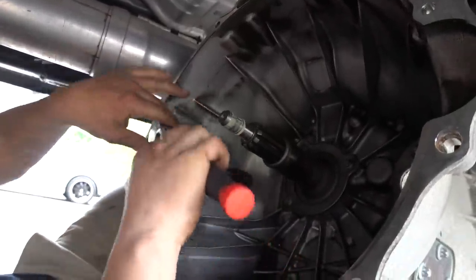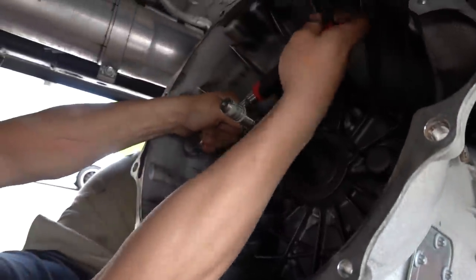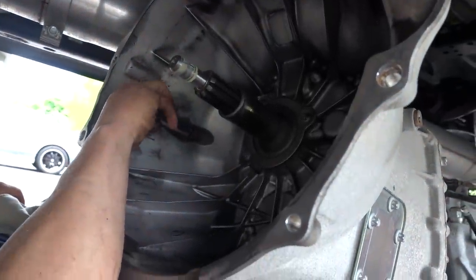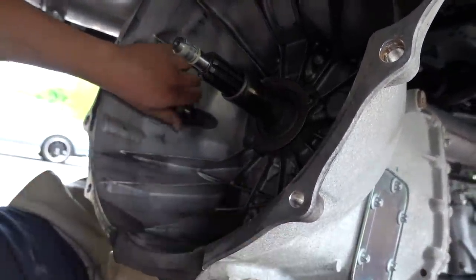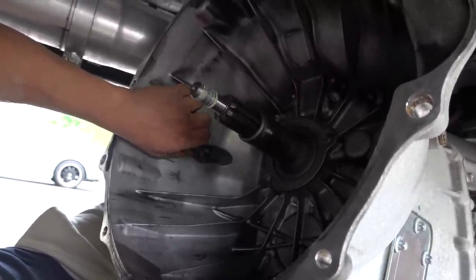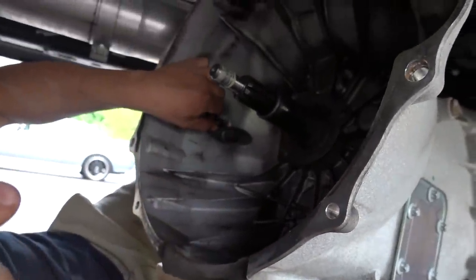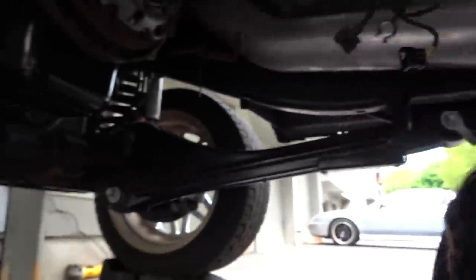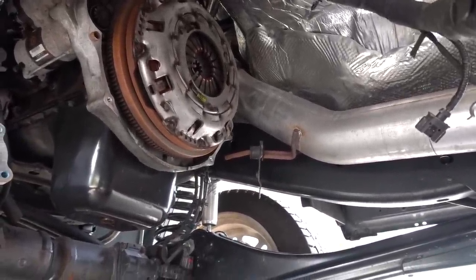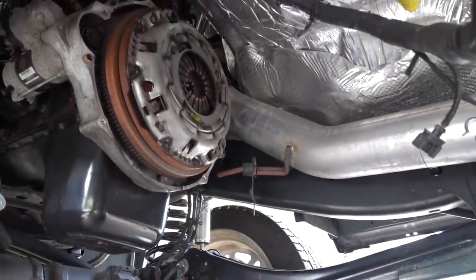They don't call him Muscle Man Andy Savage for nothing. So what we're doing now — this pivot ball has a washer behind it that you need to make sure you take out because of spacing with the new pivot arm and all that. That washer — leave that sucker out, throw it in the garbage. Put that back in, tighten it up, and go ahead and start removing your factory junk. It's very important you torque to spec. Then we'll go ahead and start getting the new stuff in there.